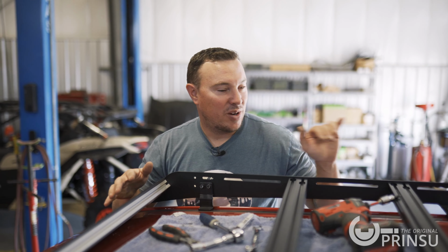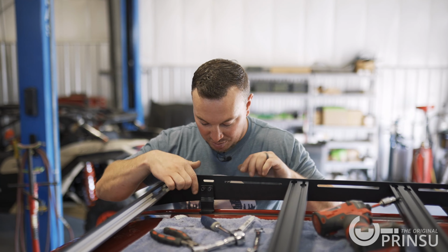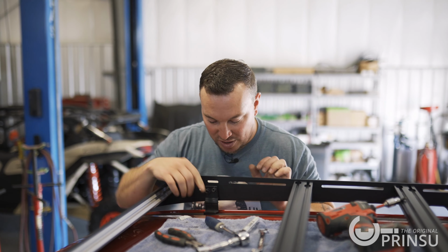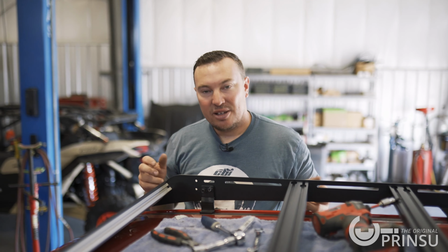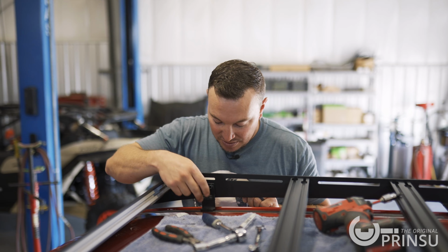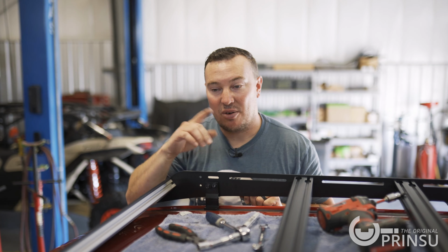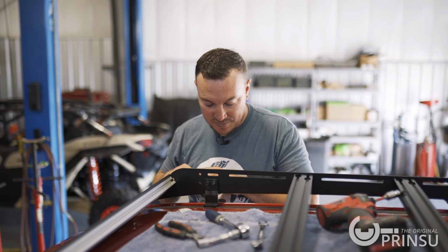Okay, so roof rack's up. We got everything started hand tight. Our silicone is in. We're gonna take a couple minutes to talk about the front mounting feet. So we have them sitting on the weather stripping. We're gonna mark it with a Sharpie, kind of slide the foot out of the way, lift the weather stripping up and cut it, peel back our adhesive, and go ahead and lock this down on both sides. So we'll go ahead and get this marked and start cutting our weather stripping.